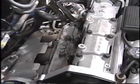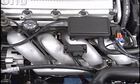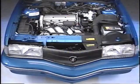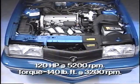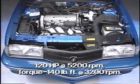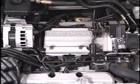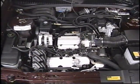The Quad OHC uses a cast gray iron cylinder block with a cast aluminum cylinder head. It features a highly tuned cast aluminum intake manifold. The cast iron exhaust manifold is also tuned for reduced noise. The engine has a compression ratio of 9.5 to 1 and produces 120 horsepower at 5,200 RPM. Torque peak is 140 foot-pounds at 3,200 RPM. Buick's powerful 3300 engine is standard on Skylark Grand Sport models and optional on the Coupe and Sedan.